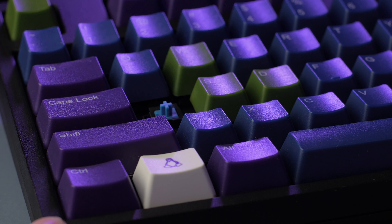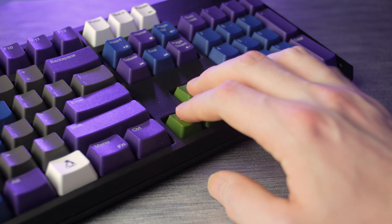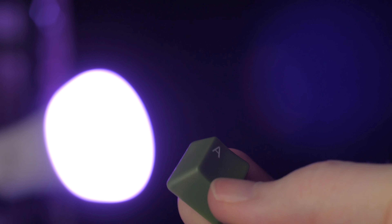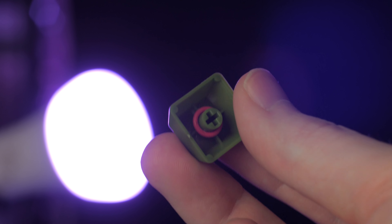The problem with my last keyboard was that my typing kept giving my fiancé headaches. MX Blue keys are prone to bottoming out from heavy typers, which results in a very sharp sound from the plastic hitting the base — it's not pleasant. So to avoid this, I had them install O-rings on these keycaps. These are little rubber rings that go around the keycap's stem and prevent the key from bottoming out, and thus keep them much quieter. It took a couple days to get used to not pushing the keys down as far, but it works great. Here's a sound comparison using the Zoom H1 Handy Audio Recorder — not sure if it fully conveys how it sounds in real life, but it was worth a shot.